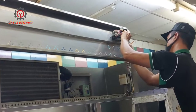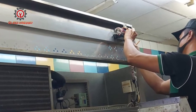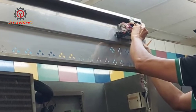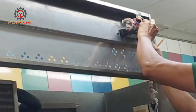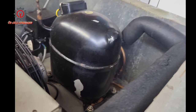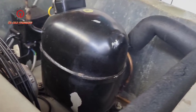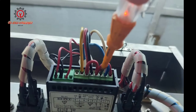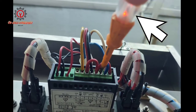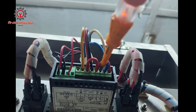When I checked the unit, I found out that the relay for the compressor is still engaging even though the light indicator on the control is in OFF. As you can see, my test pen is still lit up even though the compressor indicator is in OFF.